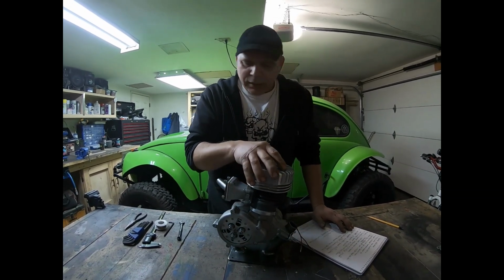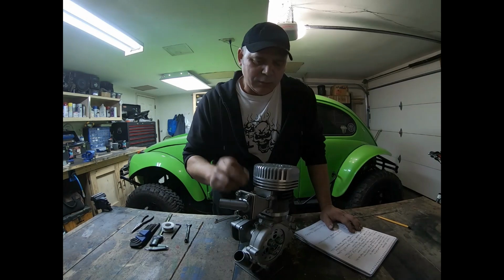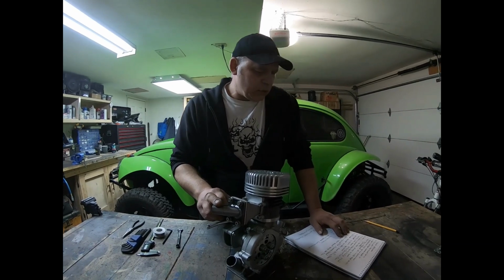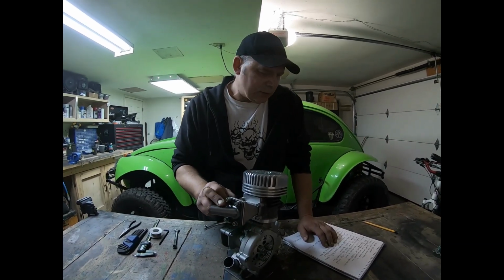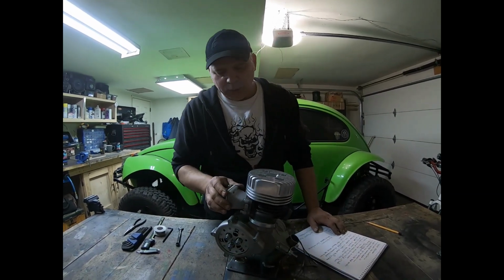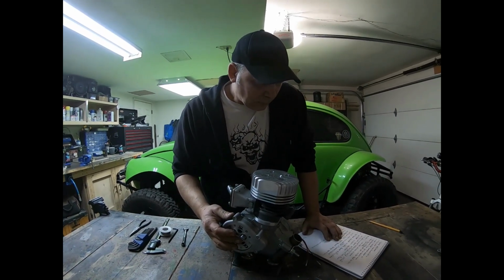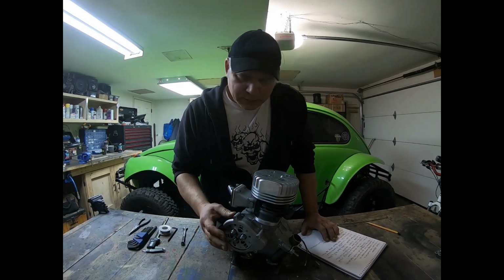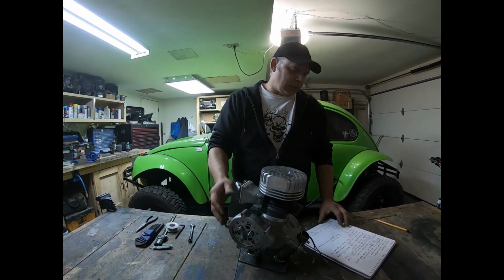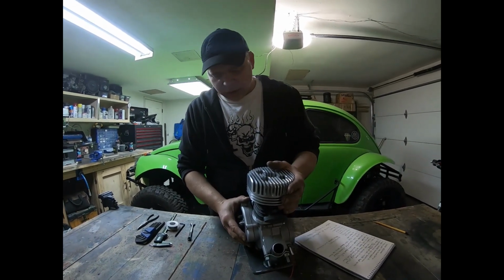The G2 reed has been upgraded to a 6 millimeter bolt. It's got reed stuffing plates inside it with a VM18 machined flat pressure welded intake. We put on it an SAF super clutch, 700-pound springs, and the springs on stock pads have been ground down to 18.6 millimeters. So that's pretty much everything I did to this engine.